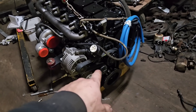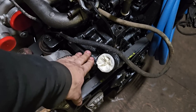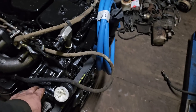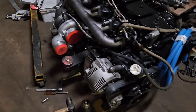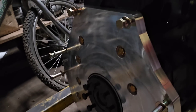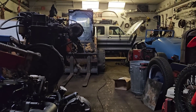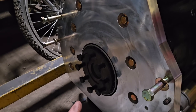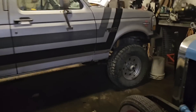You will need a different belt, but that's dependent on whether you have the adapter — I built this one, so this adapter to put this alternator on really changes the belt. Your belt length is going to vary based on which adapter you buy. Another one is the flywheel, which I don't have yet — it's at a machine shop. The factory Dodge flywheel from certain years has the right bolt pattern for an IDI clutch if you have an older 7.3 IDI diesel, but the Powerstroke has a different bolt pattern. So if you're replacing one in a Powerstroke and you want to use the clutch from the Powerstroke, you have to get the flywheel drilled. You also have to get the flywheel hollowed out to put in a different pilot bearing to go into your Ford transmission.